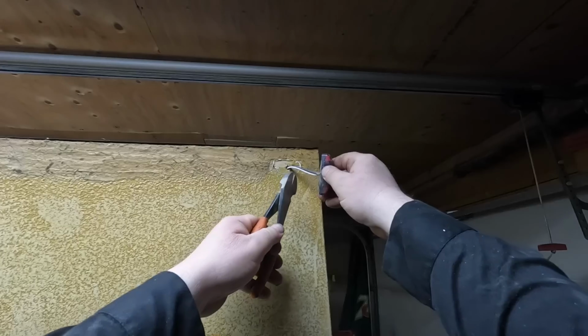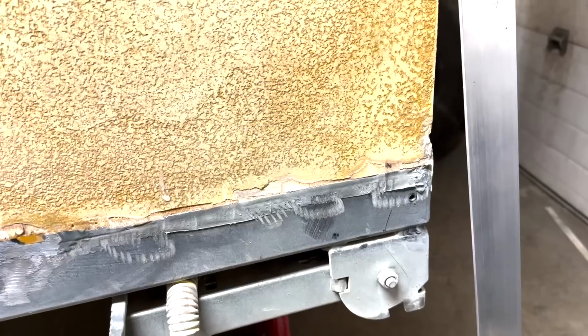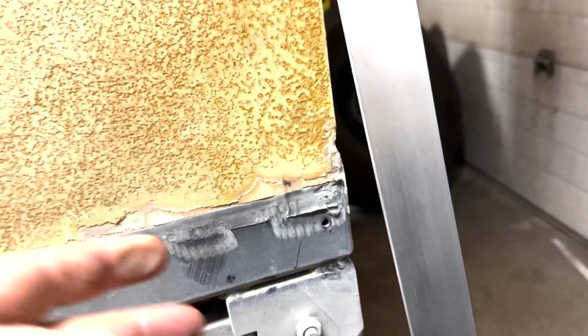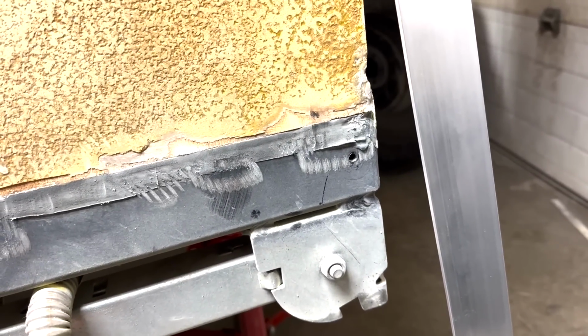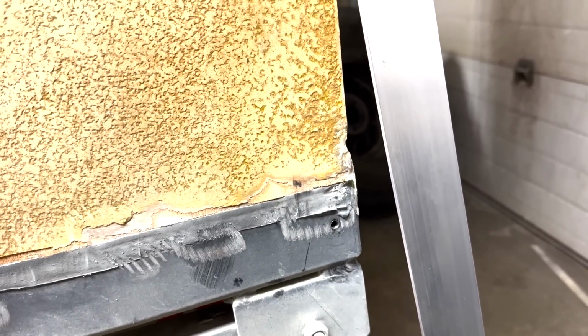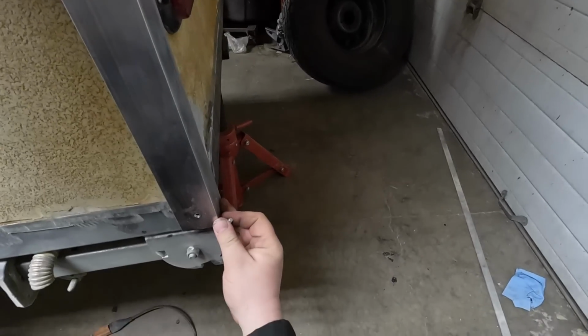What I need to do is cut these lights off. So I'm going to tackle this. I drilled the top one hole in there, going to fit the angle iron up and then drill the other hole. Learned a lesson a long time ago: don't drill both holes at once, because there's probably a pretty good chance they won't line up afterwards. It's a little bit more extra work, but this ensures that you're not going to have any issues. My piece of angle iron.